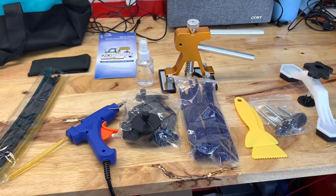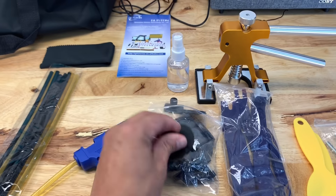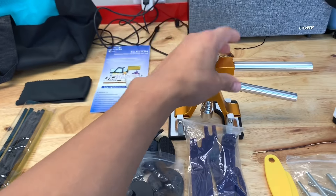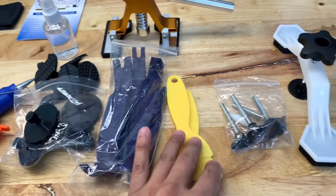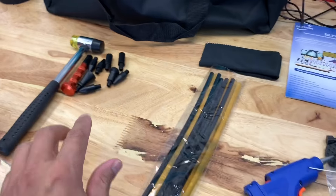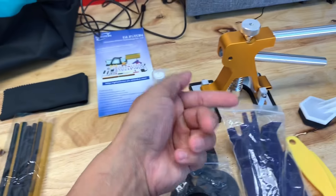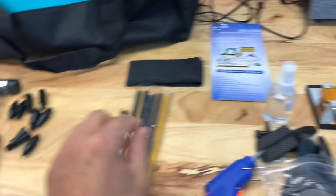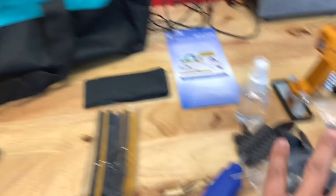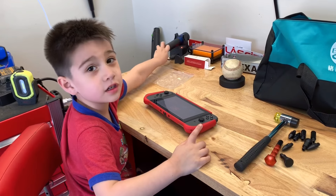Alright guys, so this is what you're going to be getting in this kit, and I'll put it in the description below where you can get yours. You get a bunch of glue sticks, a hot glue gun, all these glue tabs here — a whole variety of different kinds — a little bottle for alcohol, this is the puller, some door panel poppers, little scrapers, and also this little bridge puller with adapters. One thing that didn't come with it that you definitely need is a little hammer and these knockdown tabs and a knockdown pen. When you pull a dent too far and it makes a little crown, these knock it back down flat. This came separate — I got it for about eight bucks on Amazon. The kit also comes with a carrying bag, which is pretty handy, and a flashlight.